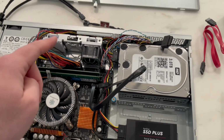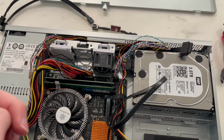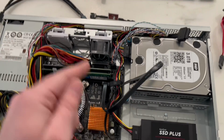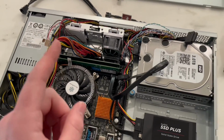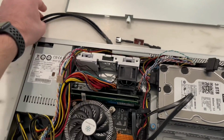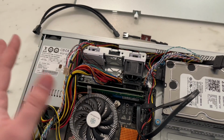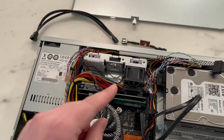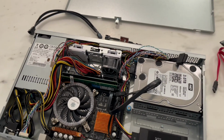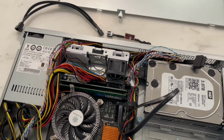So at this point, I think I'm gonna order two PWM fans that can be controlled from like 1,000 RPM to 1,500 RPM. So mainly the problem here is that the 40-40-28 fans that are included are not 4-pin, they're just 3-pin, so they can't be controlled. And that means they'll run at full speed the whole time. So I can either use this splitter to have two fans running at approximately 6,500 RPM, which the noise was fine, or I can order two fans that are 4-pin PWM and be controlled. So I'll have to evaluate what I want to do here, but for now I might just use the splitter to have the power and run both of these at 6,500 RPM and see how the noise is.